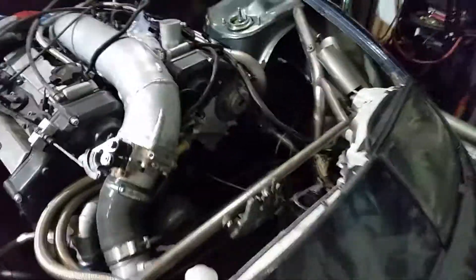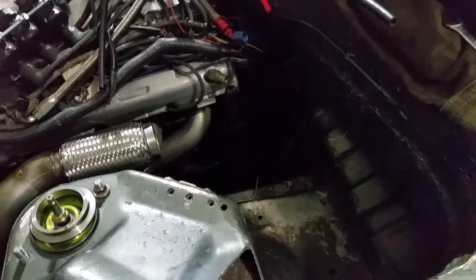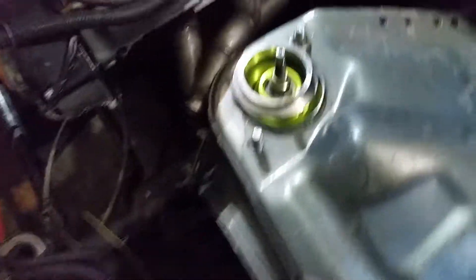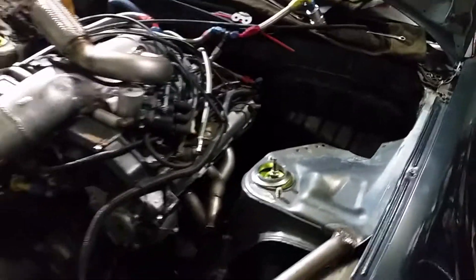Look at this car — a little preview. This is the opposite side of the turbo exhaust flange, which I have not built manifolds for yet. However, this side is coming right along. I'm going to have the ability to put multiple turbos right here for easy swapping in under an hour. Both sides join up and collect into this one, which will then go into the turbo right there. It'll be sitting where the battery used to go.